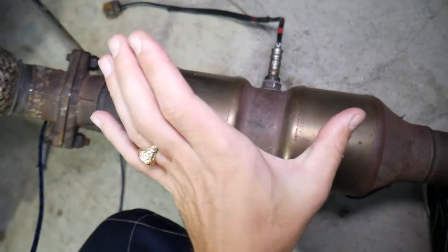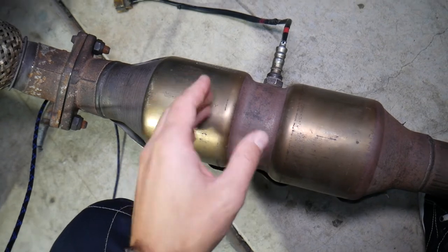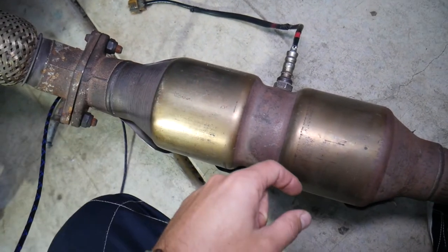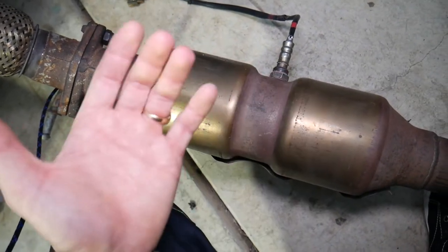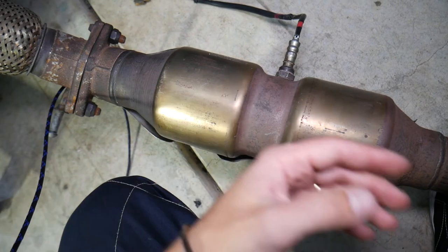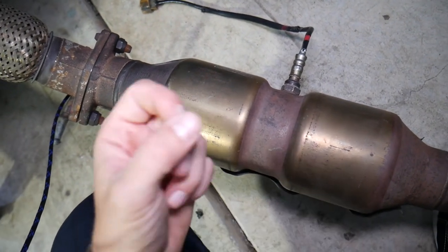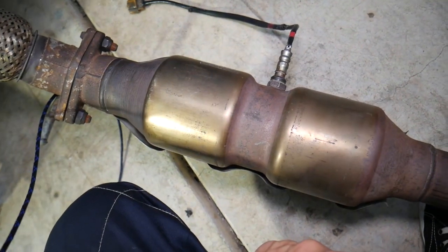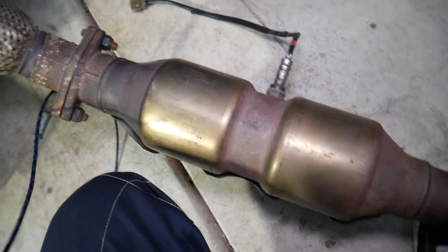Now, another thing, it could be a bad catalytic converter. But before you replace it, I recommend running additives for cleaning the catalytic converter. I'll put a link in the description of the video below where you can get it from, so check it out. You run that through the exhaust a few times and often it will clean the catalytic converter and get rid of that code. So those are the top three things that usually cause it: a bad oxygen sensor, a bad catalytic converter, or a dirty catalytic converter. Hopefully the video will be helpful.